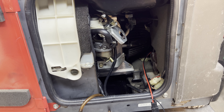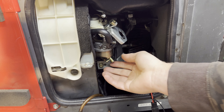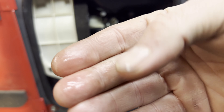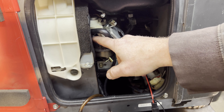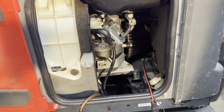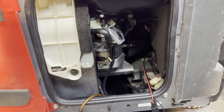While that oil was draining I cleaned my hands off, and when I touched the bottom of the carburetor I'm getting gas on my hand — so that tells me we do have something going on in the carburetor. I'm going to turn the gas off and pull this carburetor all the way out, take it apart, and see what's going on.